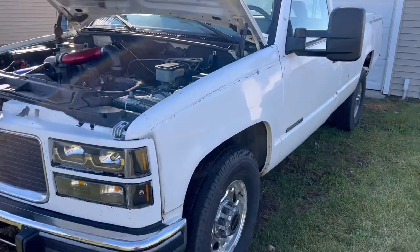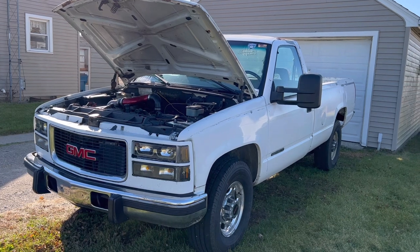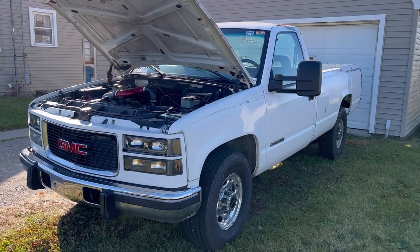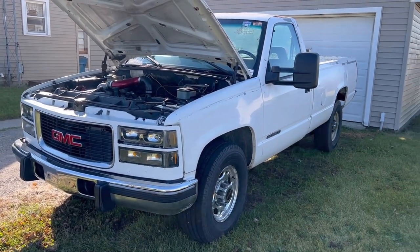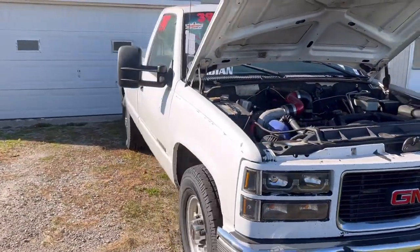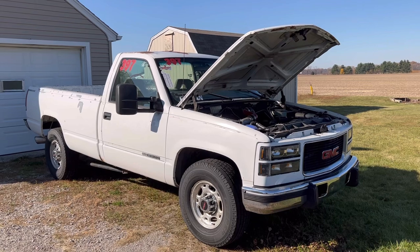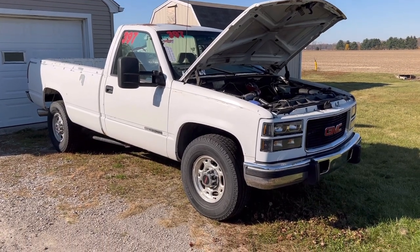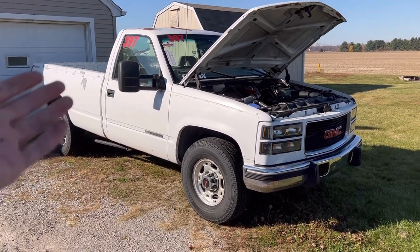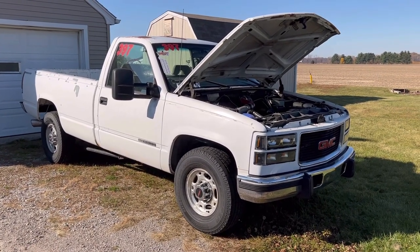I really hope this helps some of you guys going forward with troubleshooting, especially if you're having fuel pressure issues. Definitely consider that these trucks are 25 to 30 years old now, and those tanks do delaminate inside — that coating can peel off, fall, or just over time with old fuel it can sludge up and clog the sock. You've got two options: buy a stock AC Delco sending unit, or do a Quad Star Tuning draw straw style with the billet sender. That's what's in Casper, but that's a little more than your average pickup truck. Happy troubleshooting, thanks guys.